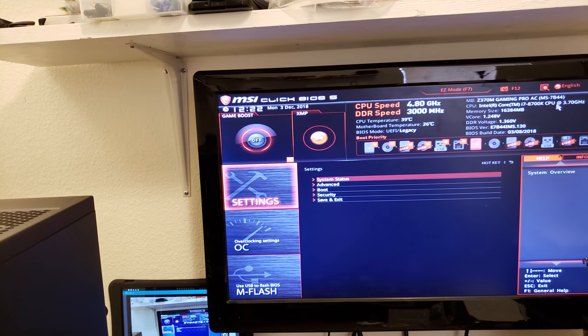It's been a few days since I gave the computer back to my client. That evening when he picked it up, we turned it back on and went into Windows, and the CPU cores — all six of them — were within one degree Celsius of each other. Without the fan on the CPU cooler it was going up in temperature pretty quick, so we shut it down. He texted me a little bit later that evening, extremely excited and happy — he had overclocked it to 5 GHz and the CPU cores weren't going above 70 degrees Celsius, which is a very successful overclock and certainly within a reasonable temperature. I hope this information was helpful to you, thanks for watching.